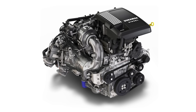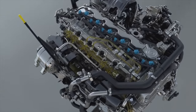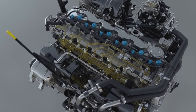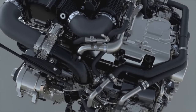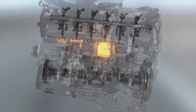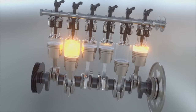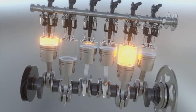The block of the LM2 is constructed from cast aluminum for the same reasons as the head — weight and thermal efficiency. The LM2 has a different end goal compared to larger diesel engines like the L5P Duramax, so it doesn't need an iron or CGI block. Aluminum is more than strong enough here because the target power levels are much lower than the bigger Duramax engines. GM claims using aluminum saves approximately 25% of the weight over a comparable cast iron engine block.